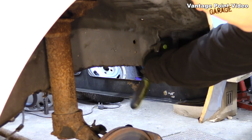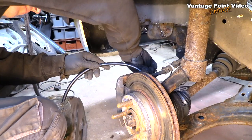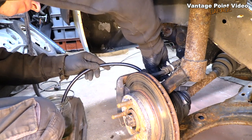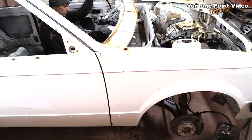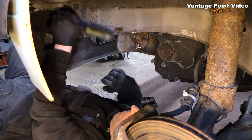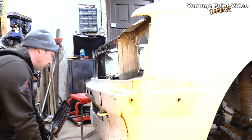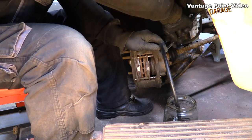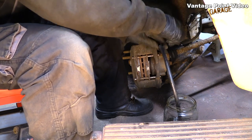I'm going to remove the front bumper. There's just two bolts in here on the inner wing, and there's another pair on the other side. But before I go in there, I will tighten up the bleed valve and move this brake fluid over to the other side, so I don't want to spill that on myself while working under the car. Another couple of pumps to the pedal and that'll get the other section of the master cylinder drained. Back to the front bumper — it's now safe to remove the bolts on this side. I'm going to remove the front wings so that I'll be able to do surface treatments on the inner wing sections, so it's necessary to have the bumper off.